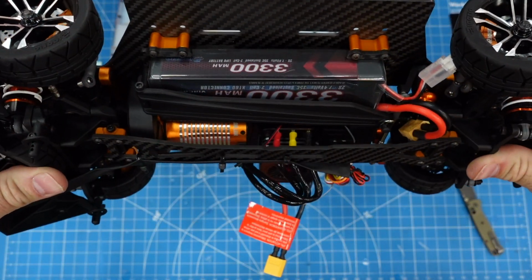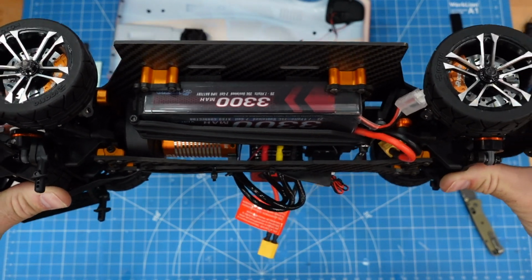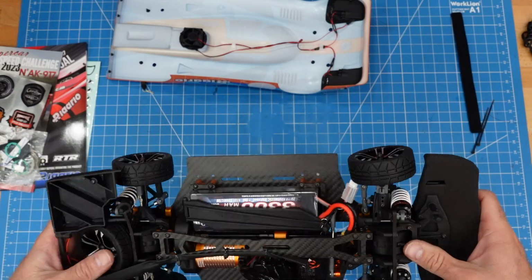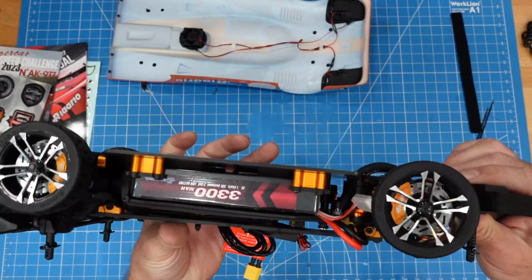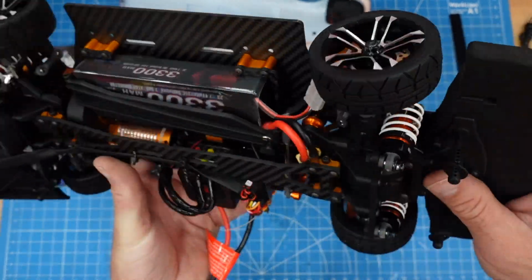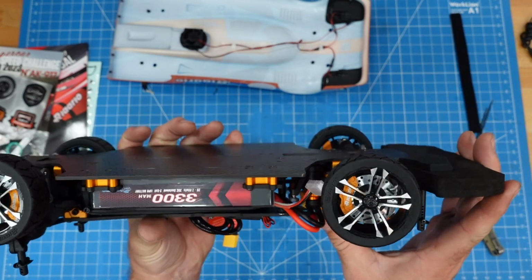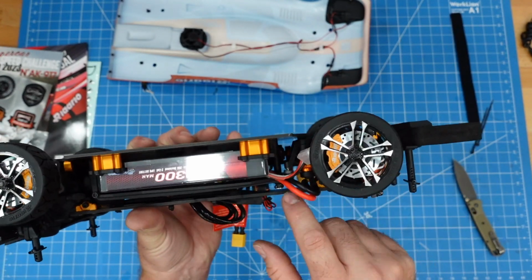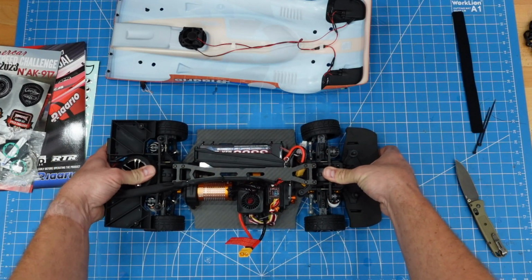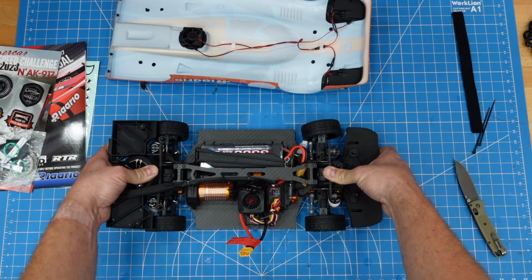So when you flex the chassis, that upper part flexes. And actually sometimes, you know, I would almost suspect that it might be designed to flex because you've got these orange brackets here which act like a pivot. Like they're intentionally offset, so you kind of create a moment that acts on this beam and flexes it. A lot of cars you want some flex in the chassis, and so I suspect that this might be kind of an engineered flex system.